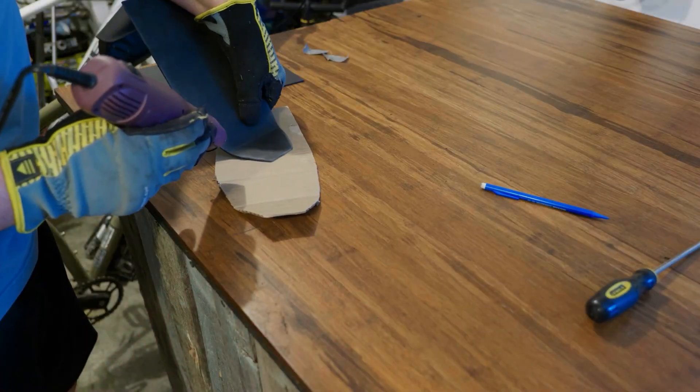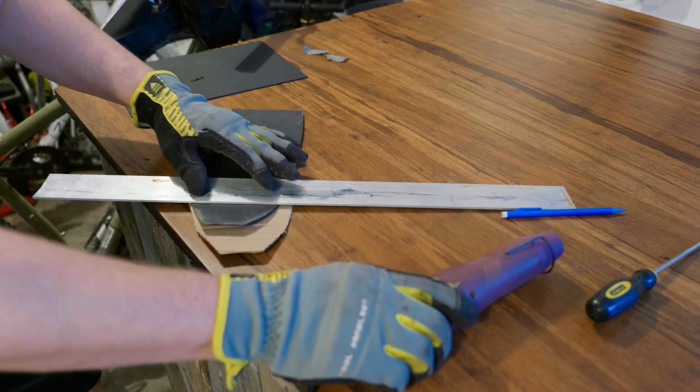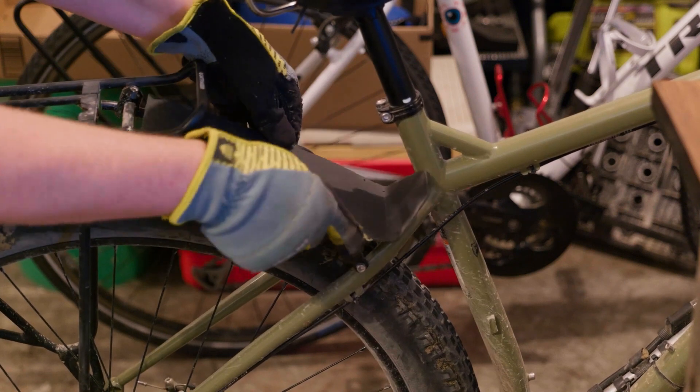That's going to be a different material and zipper for the final piece, but this has worked out pretty well so far. If you've been thinking about a way to use fenders with your racks and you get some Kydex, you can very easily do this — just a heat gun and you can put the bends in easily. You can shape it, drill some holes, and attach it to your rack with some zip ties. That makes it really easy.